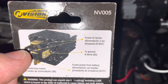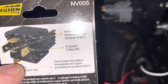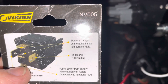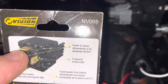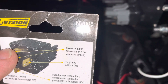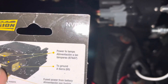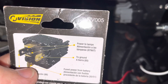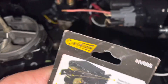Terminal 86 will be the purple wire coming from your ignition switch, so your ignition switch will turn this relay on by putting power there with terminal 85 as the ground. Then this terminal down here says fused power from battery, and what I'm going to do is run a fused 14 gauge wire from a nearby 12 volt source to that terminal. Then terminal 87 here is going to be power to the ignition coil, so the ignition coil gets a separate source of power on a 14 gauge wire and it doesn't tax the purple wire. I think the purple wire is already taxed enough.